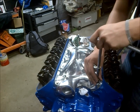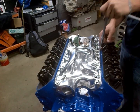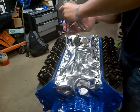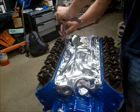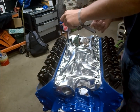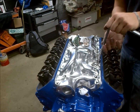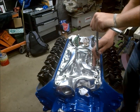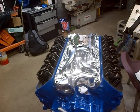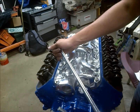I like to shoot for something in the neighborhood of 20 foot-pounds, and after I run the motor I go back and recheck those. That's nice and easy on these Fords because the bolts are straight up and down — on the Chevrolet it's no fun at all. So Ford definitely has a Chevrolet over the barrel with that. If you've got an aluminum intake and you want to do it right without cracking it, that's something to be mindful of. I'm going to take them to 15 and then to 20.